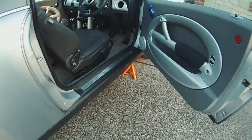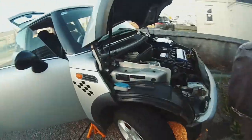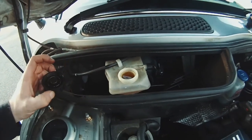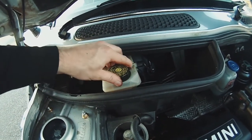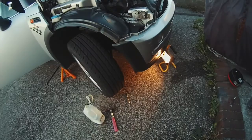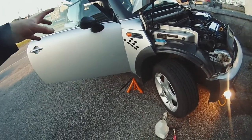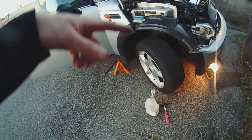And then what I'm going to do now is drop the Mini down. I've double checked the reservoir level, and that's back up to where it was. Again, I have to just mop this up. So we'll do that up. And we'll have a briefing in the house, and I'm just going to patch all this up in a minute. Get rid of the light, drop it down, level up the wheels, have a quick scoot around all four wheels with a cloth and a 10mm spanner, make sure everything's done up, and then I'll meet you in the house. Okay. Simple job. Hopefully you've seen it all. That's my biggest concern, is if you've seen it all. Hopefully you have. So see you in the house.